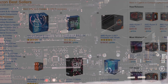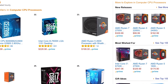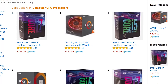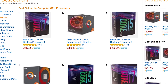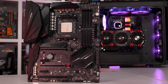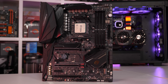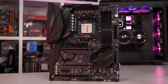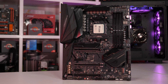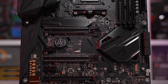At the time of putting this video together, the Ryzen 5 2600 sat in 23rd position on Amazon's bestseller list, while the Ryzen 7 2700X claimed second spot behind the 8700K and the R5 1600 was in fourth. It's pretty shocking to see how far back the R5 2600 currently is, but that might be because AMD refused to supply samples ahead of the release — they obviously wanted their more expensive X models front and centre. Personally, I do prefer the cheaper Ryzen 5 2600 to the more expensive 2600X, as I'd be upgrading the cooler regardless, and low-latency DDR4-3200 memory seems like the way to go.